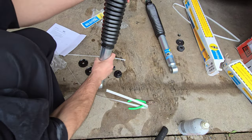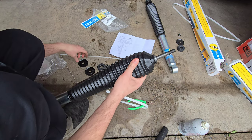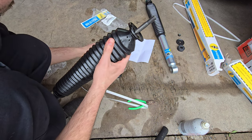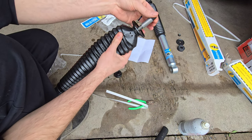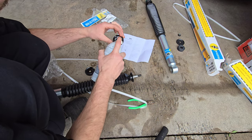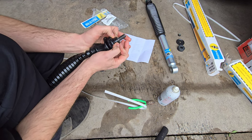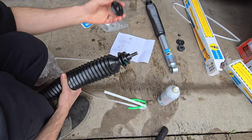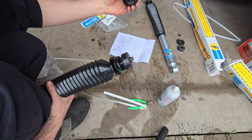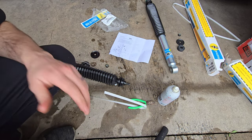The shock does come with directions, so you can follow those or the video. First, grab the lower washer and slide that on, then grab the sleeve and slide that on, then grab the lower bushing with the point on it and slide that on over the sleeve. Now it's ready to be put in the truck. Once it's in, take the upper bushing, then the washer, then the nut and tighten it down. Now we have the bottom half of the shocks built.